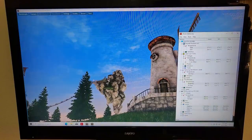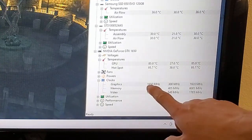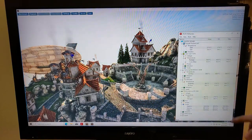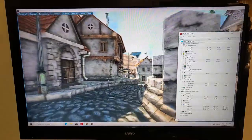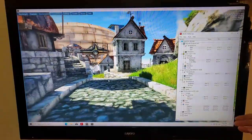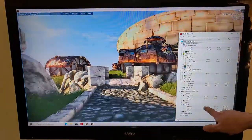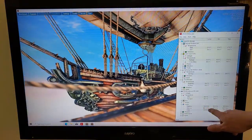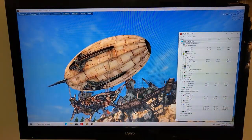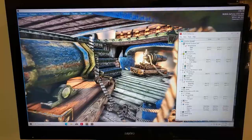We've been cooking for almost 10 minutes and the GPU temperature has plateaued at 84 degrees, sitting at about 1,650 MHz. When the temperature was lower in the 70s we were at about 1,850 MHz, but once we broke through into the 80s it immediately dropped to about 1,800 MHz, and every degree past 80 we dropped more until we settled at 1,650 MHz. When it was cool we were at 1,920 MHz — so we lost roughly 300 MHz, which is not insignificant.